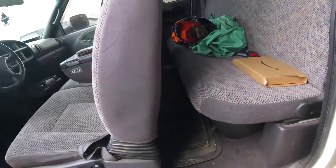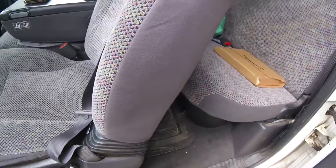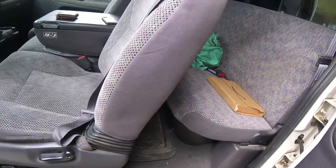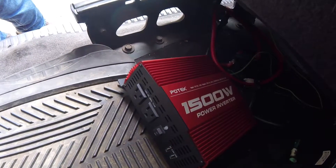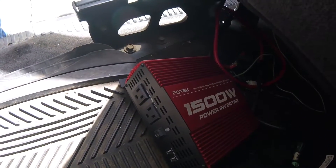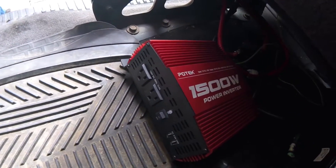It's all installed now. It's not the coolest thing in the world but it's a pretty cool thing to have in your car and not too hard to install. Keep an extension cord in your truck and you can plug in all kinds of stuff — if somebody's tire goes flat and you have a small compressor you can inflate tires. You can do all types of cool stuff with it. Just be careful picking the watts: a 500-600 watt inverter won't power much beyond charging laptops or small things, but with a 1500 watt it's middle of the road — you can run power tools, a TV, bigger stuff, but not something like a welder that takes a lot more watts.